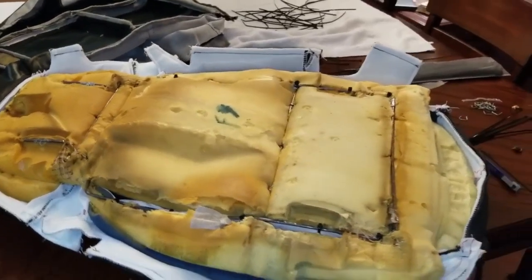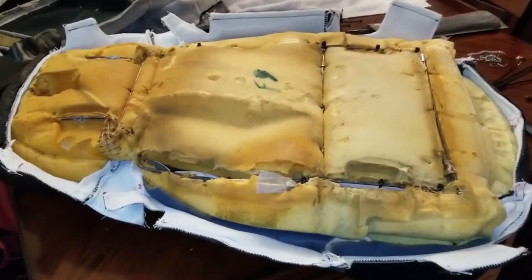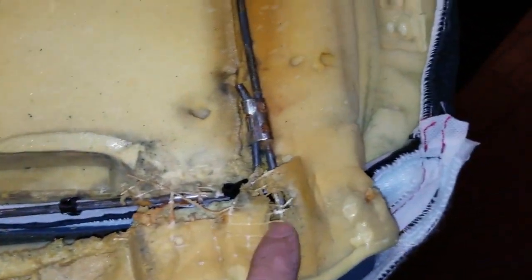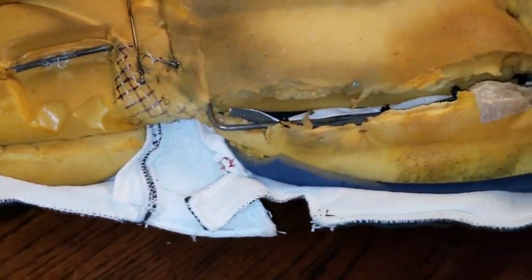My GoPro died, so I had to start over with my phone camera. Anyway, this is the way it looks after it's finished and all tucked in. You can see I got all the metal hooked on, the rods are through, and I've cut all the excess wire ties off. I've wire tied all of the fabric inside the grooves all the way around. I'm going to go ahead and flip it over so you can see it's all nicely tucked in. The next step is to flip this back over and start hooking this fabric onto the metal rail, which will tighten everything up. Once that's done, the seat's ready to go back in the car.